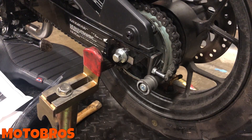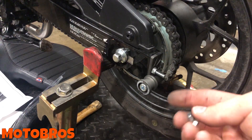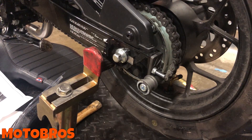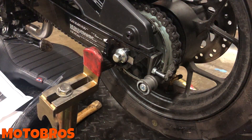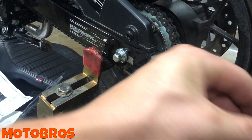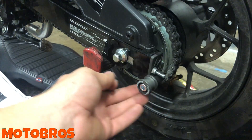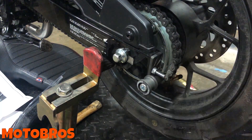It really doesn't get any easier than that — repeat the process on the other side. The reason we replaced the two nuts is to avoid dealing with them stripping out. With one lock nut on the end it's simpler. You can also safety wire your spool to the swingarm if you prefer. These do come with a lock nut on the bottom, but for racing situations I don't want to have to reach under and loosen it. One lock nut — done.